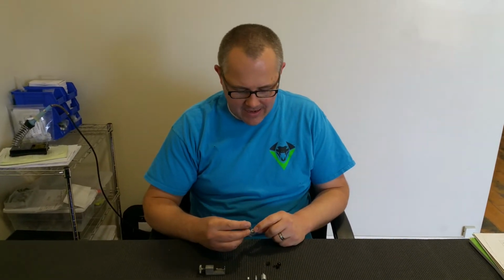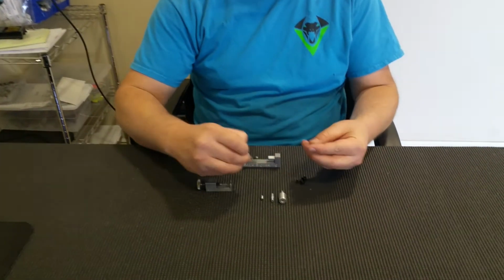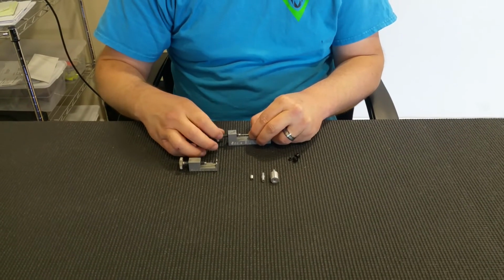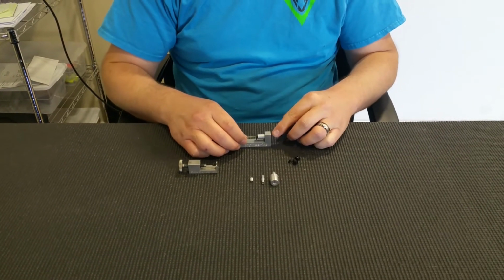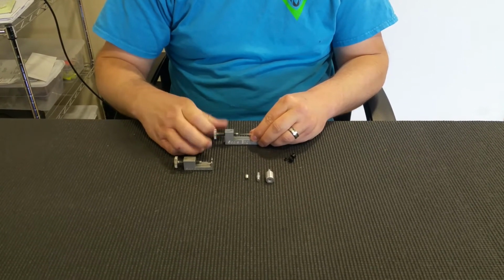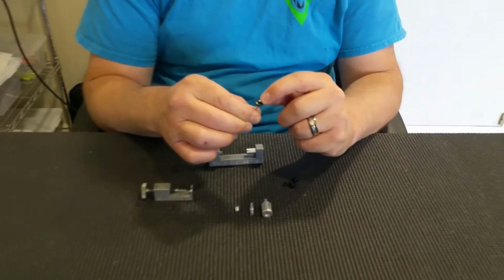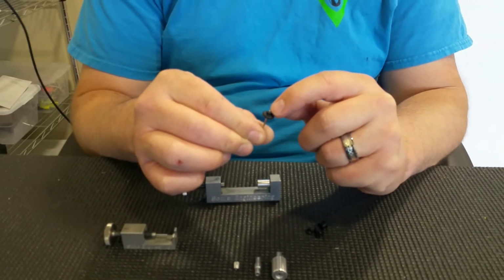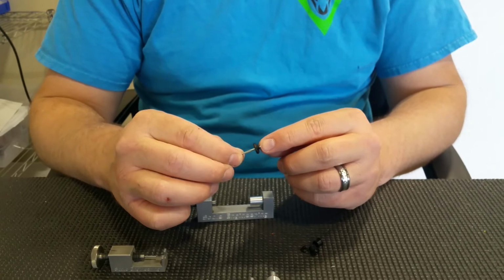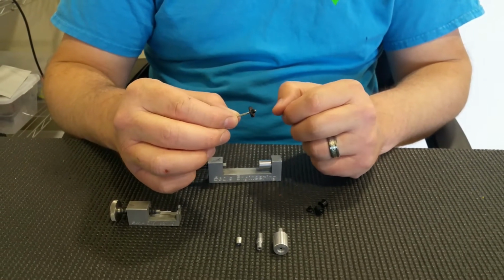So we have our gear adapter in here. That's where I like to start first. I like to take gear and an axle and press them on. The Scale Engineering has a screw inside so that you can set your depth. I always start to press it on, press it through just a little bit. You want to make sure there's no burr sticking out the backside. Sometimes there's a burr there. You can eliminate that by chamfering both sides of the gear or polishing the ends of the axle.